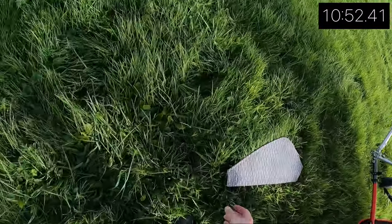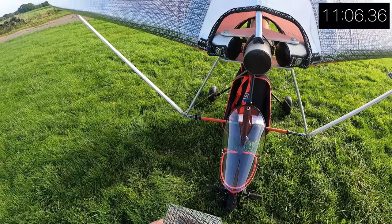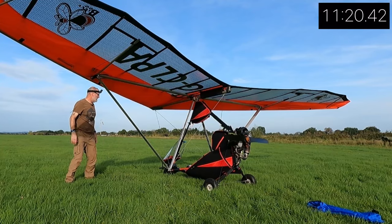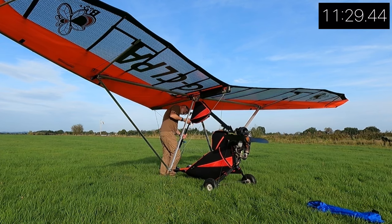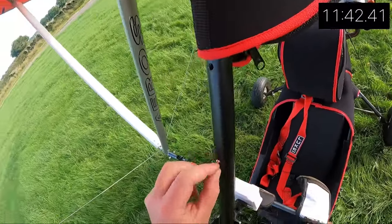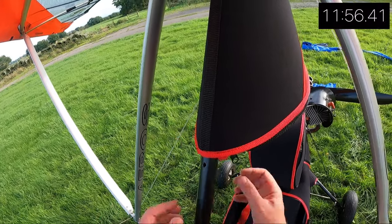The next thing to do whilst you can still reach it is to put the nose cone on. Do not be tempted to fly without this because it will affect the handling. There's velcro on both sides matching up with velcro spots on the nose cone — you put it on the right way around and it simply attaches on there. Then lift the wing into place: lift it by the control bar, lift the wing up, and you hear a click. That click was a spring-loaded tab — the front strut has a tube inside a tube which lets it slide up and down, and when it reaches the right place these spring tabs fire out and lock it into place.